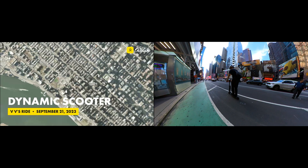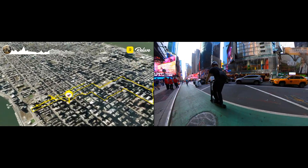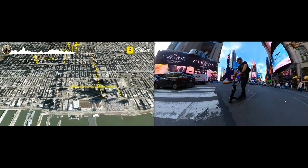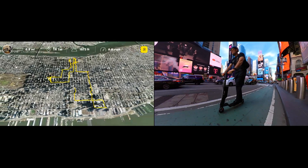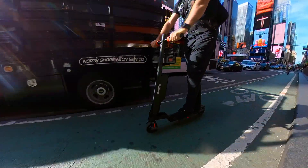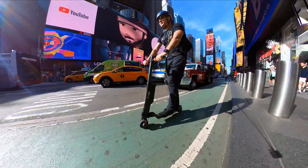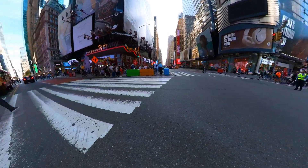Range — I weigh 225 pounds, thus 5 pounds over the limit of the scooter. And I'm surprised this model survived one week on New York City streets. I'm riding always at maximum speed and I was able to cover 6.8 miles in range, which is very impressive from such a tiny battery. In the last battery bar, the speed was reduced to 10 kilometers an hour, sometimes a little less. But you can continue at 6 miles an hour and cover more range.